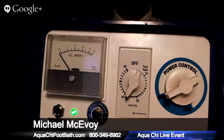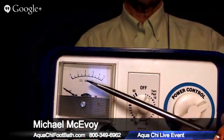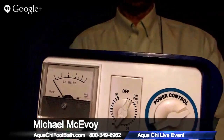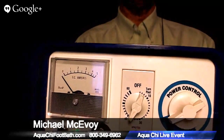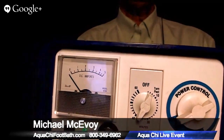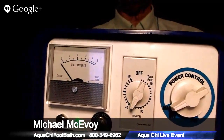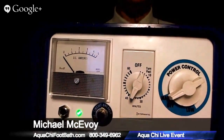But the ideal reading, let me get a screwdriver here. The ideal reading is going to be between 2 and 3. Look at that. Doesn't like my screwdriver. Okay, so the way to get that reading between 2 and 3 is to sprinkle in a little bit of salt at a time, allow it to dissolve, and when it reaches about 2.5, that's when you want to stop adding your salt. If you do put in too much salt, you may have to turn down the power level control a little bit, but don't worry about that. That's okay. Just don't do it every time because you'll wear out your ring sets faster. Too much salt means wearing out those ring sets sooner.